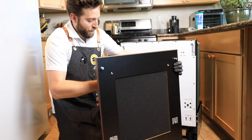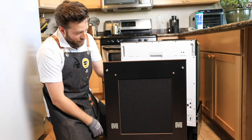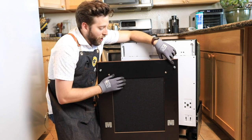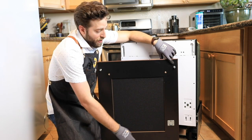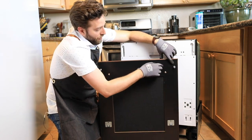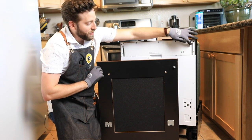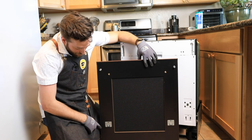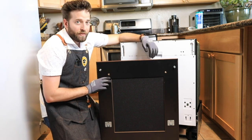On the back here, you'll see how easy it is to get this on there. This actually comes with all the hardware to either install it on the door that comes with it or an extra door if you want it more customized. You install these brackets down here, which clip in, and these two keys will slide right into place. Then we'll open the dishwasher up — there are two holes here that will screw through to get the door secured.